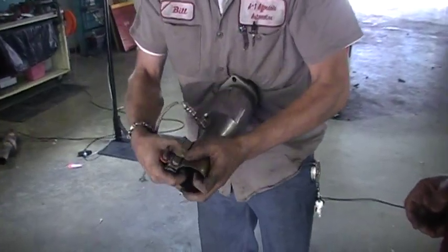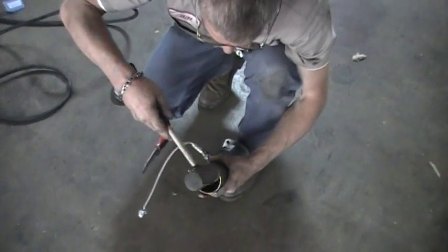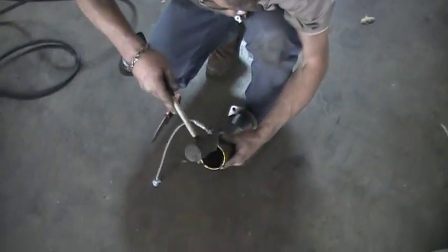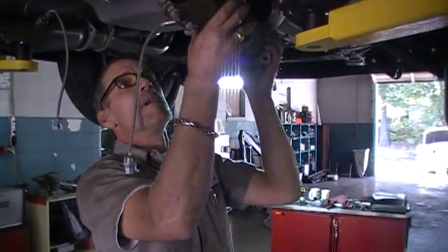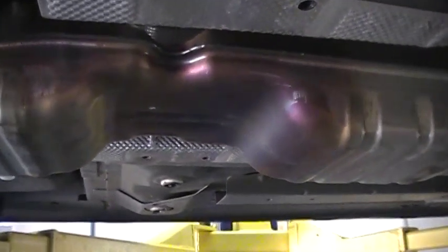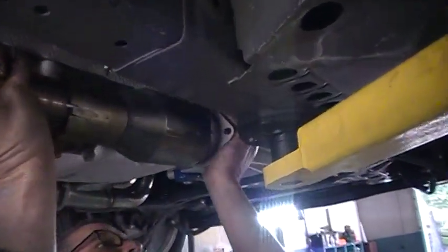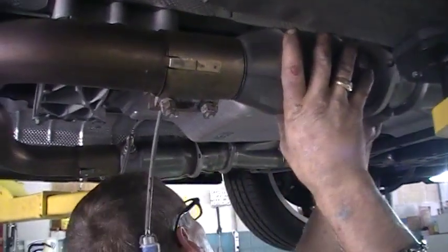We discovered something, that there might be a reason why you don't clamp the headers and torque those bolts down, because you gotta do some finagling to get the mid pipe in place. But what we're doing is putting the clamp on the cat, putting it in place, and then we loosen the mounting bracket for the muffler system, and it's rubber in the back, so it gives you room to slide that in. It slides right up there. I'm telling you, this is a good set of headers, and they were engineered well.